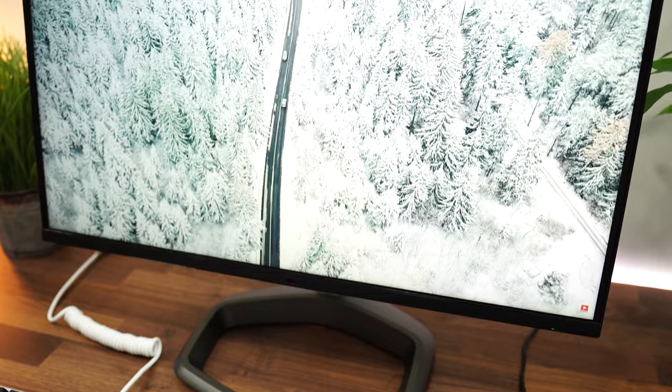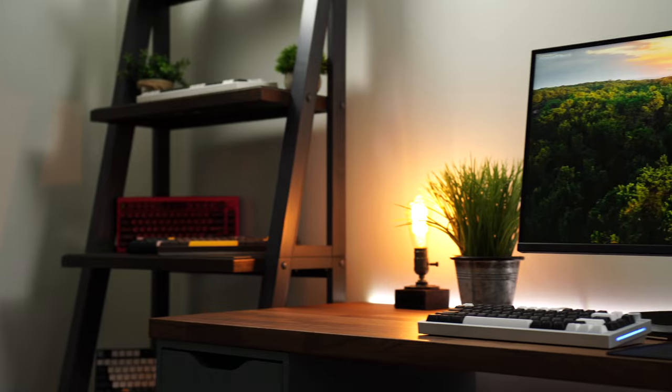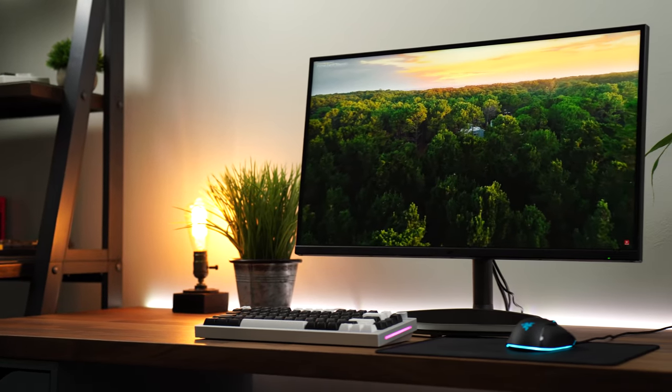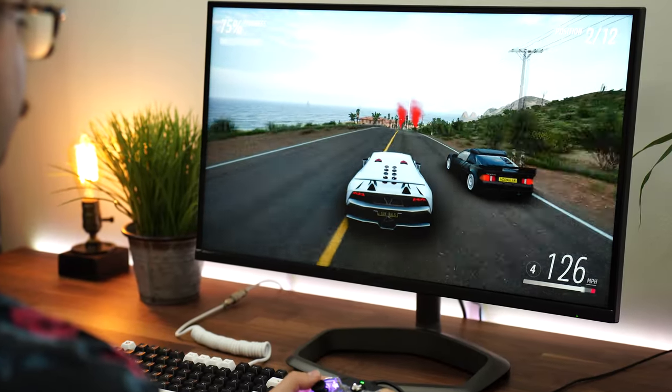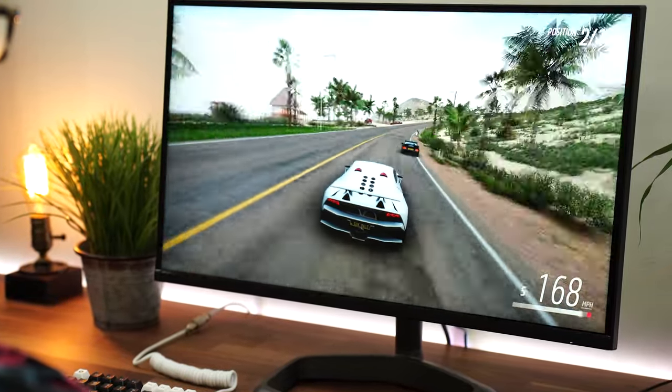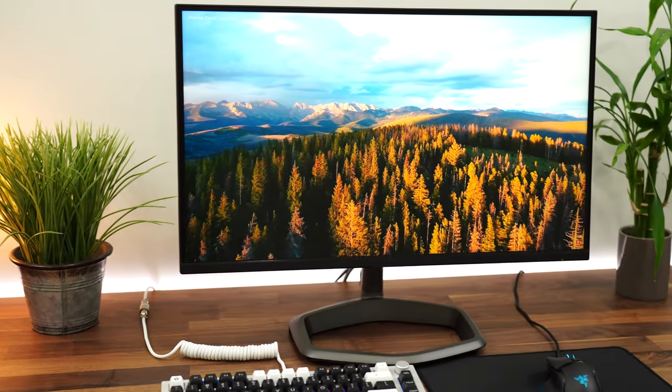This is not the same story in HDR. HDR does not have those overly blown-out areas of the screen. You could have this in HDR with local dimming on and use anything on the desktop and it would look pretty normal — more contrasty with HDR goodness, but it does not blow stuff out. So if you want the most accurate representation with local dimming on, you're going to have to be in HDR. In HDR, this hits closer to about 540 to 550 nits with local dimming on, which is still a fantastic brightness.